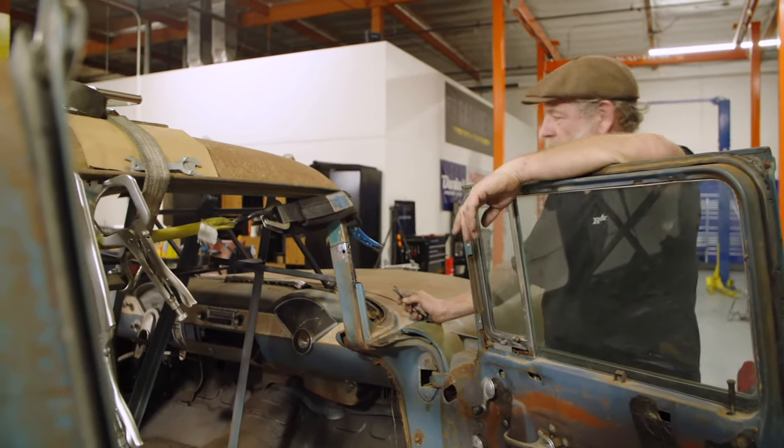It was pretty easy to fit thanks to the structure, which may look like overkill - but when Jason cut the roof off another wagon in the junkyard, literally the B-post fell down and the doors fell off, because the roof is a lot of the structure of the car. So this fixture helped us out a lot because we didn't have to do any measuring. Once we lowered it down onto the saddles in the fixture - the same in the rear side windows and the tailgate - it was in place, as you can tell by the door gap. We've just got to fix some dents in the roof and cut out the fixture, and this thing is ready to go.